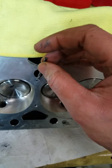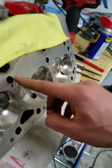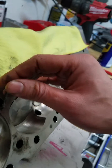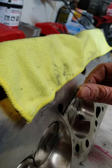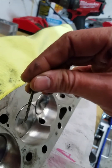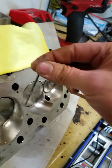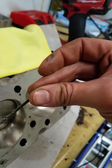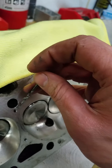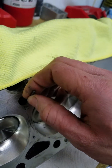On these upper holes, you're actually drilling at an angle — downward towards the exhaust valve, or towards the exhaust exit on the outside of the cylinder head. So you're on a pretty good angle on those holes. That's what makes them so deep; you're trying to hit the coolant jacket that's down there, drilling from the top down. This hole is about two and a quarter to two and a half inches — this drill bit is chucked up to the very edge just to break through. The center one is only about an inch and a half.